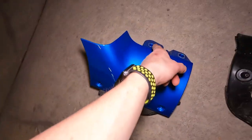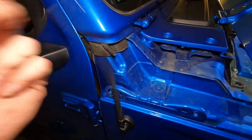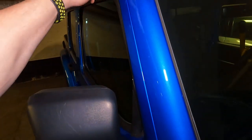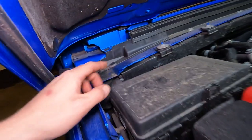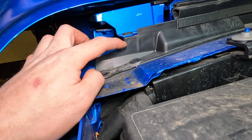Next step is removing the cowl piece — super easy, it's just four bolts right there. It does tell you to take the antenna out; I didn't because I've got a shorty rubber antenna and it moved out of the way enough. There's the roof drain that goes right through there. Now, to get the other piece on that attaches to our snorkel, we have to cut this little piece of plastic right along that bend — basically from that line down to the other line. We're going to trim that out and then get our mounting piece in.